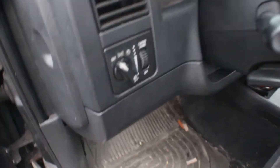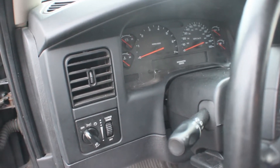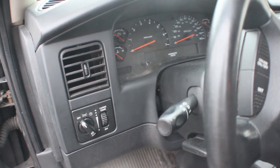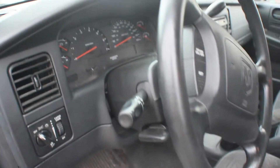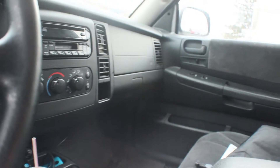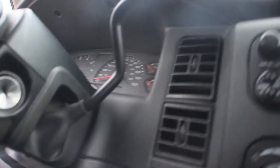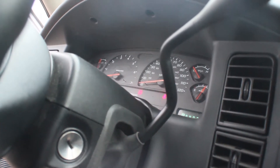After nine minutes it goes into sleep mode, which turns off the parking lights and ignition. But since it's wired in parallel with the ignition switch, if your key is in, the truck will run regardless. To show there's no key in the ignition — I'll just do it again. I sent the message, no key in the ignition, there go the lights, all the dash lights — there we go, started right up.